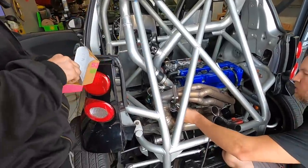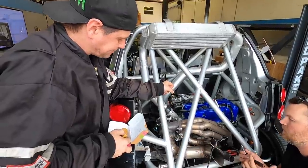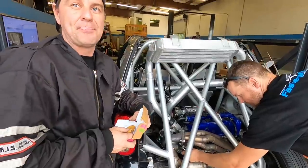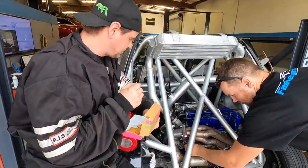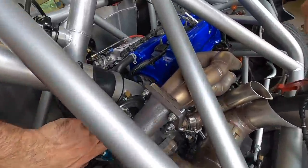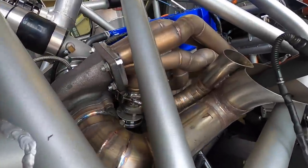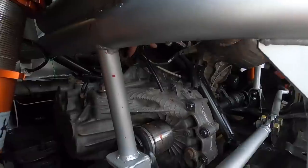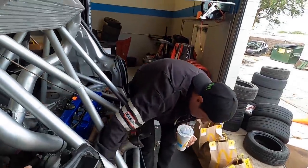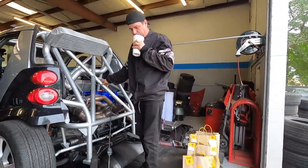So again, still trying to establish some sort of foundation before we go nuts. So basically we're just taking compressor to gate. Nothing else, no MAC valve, taking that out of the equation. All right, so we've got compressor source housing. So he's saying source, I'm used to saying reference. It's just different lingo, but same thing, to the bottom of the gate. That's it. Simple as can be. That's how it's supposed to be. We got our lightest spring, hopefully got everything under control.